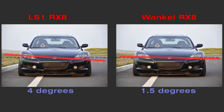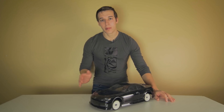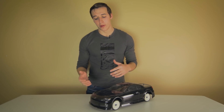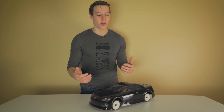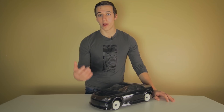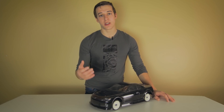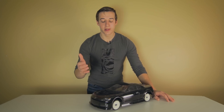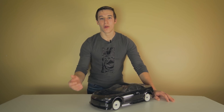So with an LS-1 in your RX-8, you'll be leaning an extra 2.5 degrees on top of the normal leaning from the rest of the car. This doesn't seem like a ton, but small angles like this can affect your suspension, camber, tire load and contact, affecting overall performance. Body roll really affects the way a car feels and drives. At the end of the day, a race car designer wants to reduce body roll, but isn't going to sacrifice that for other variables such as speed. It really comes down to what you want in a car — for people like me, that's a well-designed, well-handling chassis with an engine that fits it perfectly. It is that uniqueness and special driver feeling that keeps people doing the maintenance and taking care of their RX-8s so they can run for years to come.